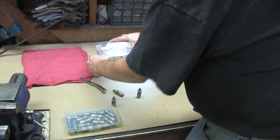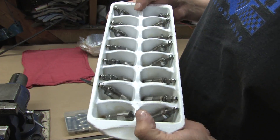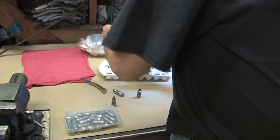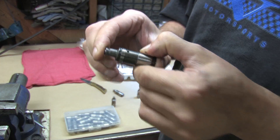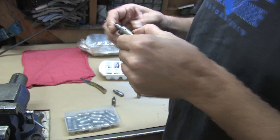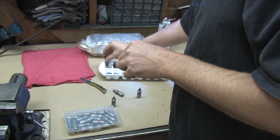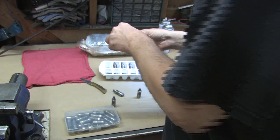I have a set of third revision lifters that came out of my GSX. There are a lot of advantages to these, and Mitsubishi now recommends using them on all 4G63 cylinder heads. When you remove them from the head, some will be pumped up and solid, and some will be squishy. This is because of the position of the cam lobes when the engine is stopped — valve spring pressure over time compresses them, making the oil bleed out. It's normal.